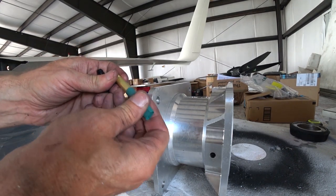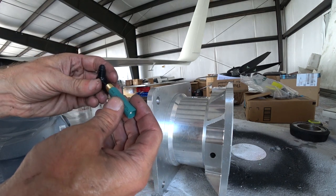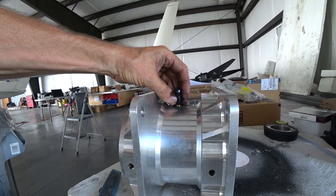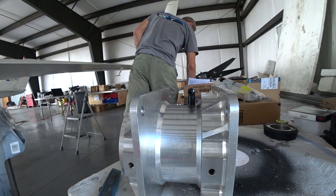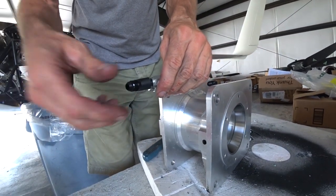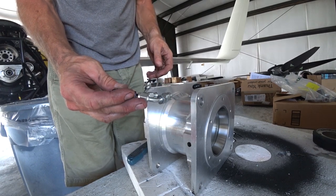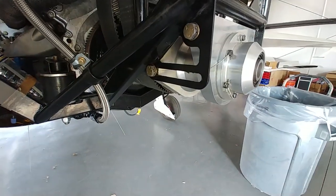Here's one of the little right-angle fittings, which is actually perfect for this job because it has a little NPT thread and then an AN fitting on the end. I'm going to sleeve that with some heat shrink, thread it in with pipe seal, and it'll go through the hole and screw into the oil collar — two of those coming out of the oil collar. For the feed it's the same thing, except the feed's a bit heavier. The oil coming out of the return is going to go with a couple of short runs of AN4, with those 45s into a Y, and then feed back AN6 into the sump.